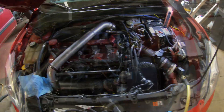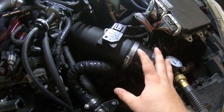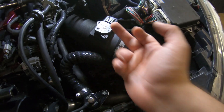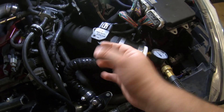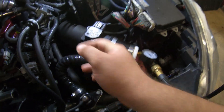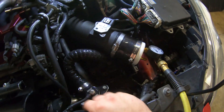Boost leak test completed, but there was one oversight I want to show you so you don't make the same mistake. I was boost leak testing from the intake, but the MAP sensor doesn't see boost — it only sees vacuum. Once I re-seated the o-ring and plugged it back in, it sealed to about 15 psi and then started leaking. Since it only sees vacuum, that's kind of an unrealistic expectation. I'm going to replace the o-ring anyway — it's cheap and very important that it's not seeing any vacuum leaks.